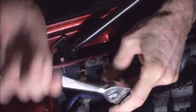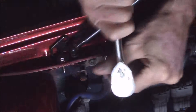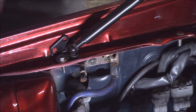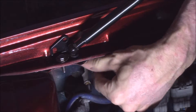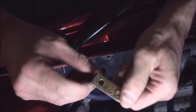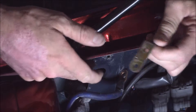I'm going to do this upside down. Let's see what we've got here in terms of a contact point. Standardized 10-millimeter connections here. The other thing is this is slightly loose, which is also another bad thing. You don't want to have your actual straps or any of the connections loose because what will end up happening is you'll get corrosion that will build up on the bottom surface between the two surfaces.